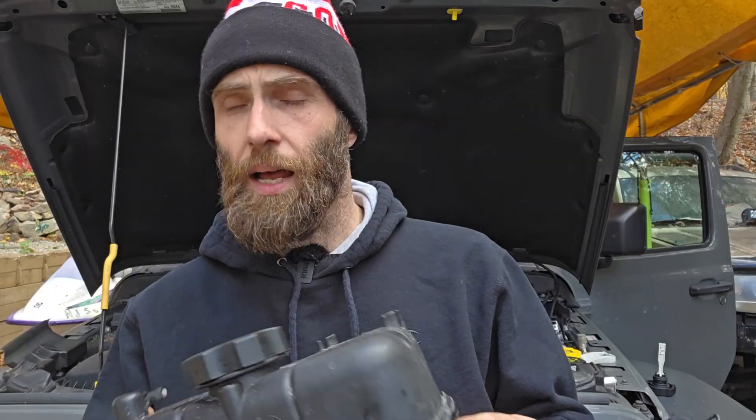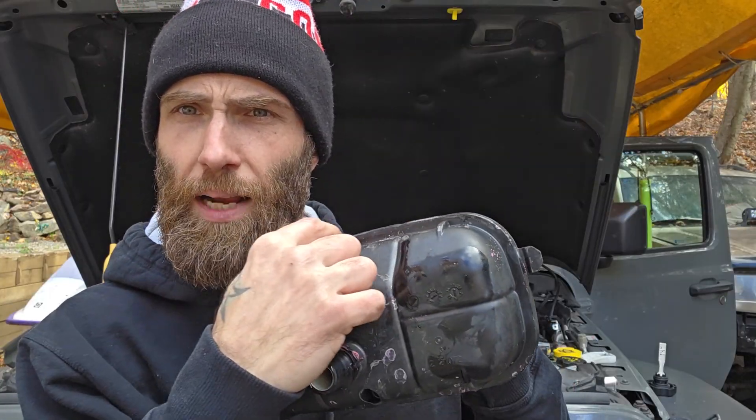As a final note: using the traditional bleed-and-fill method, I've had good luck previously — but I mention it again because I don't want to instruct you to do the same if you don't know what you're doing. If you've never done this before and you're not comfortable being responsible for whether or not the vehicle overheats, fill it yourself at home but take it to somebody else to bleed it. Because if you get an air bubble and you miss something, you could cook your engine, your turbo, all kinds of things. My advice: if you have one of these two-liter turbos, pick one of these bottles up, keep it on the shelf — maybe keep it in the back of the Jeep — because you could definitely change this on the side of the road. Or at least keep some JB Weld with you, because I've heard about people where it cracks right under the plastic weld and you might be able to JB Weld it and get yourself home.